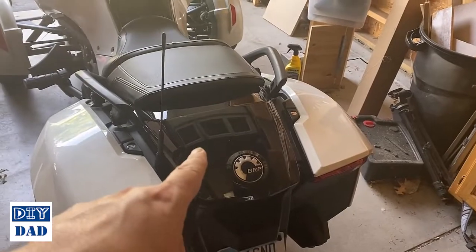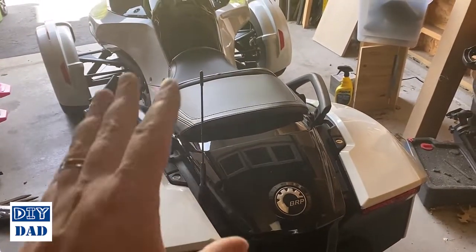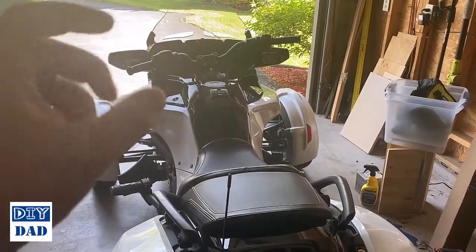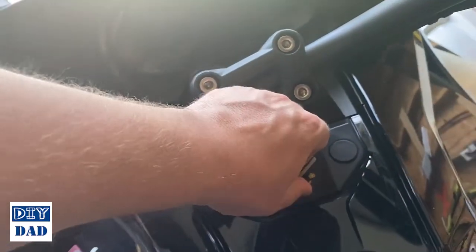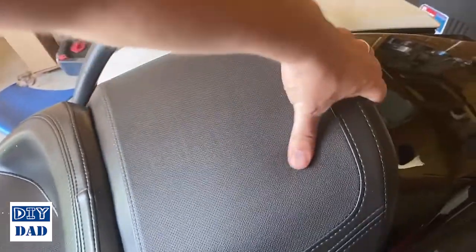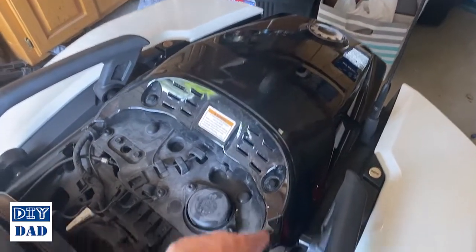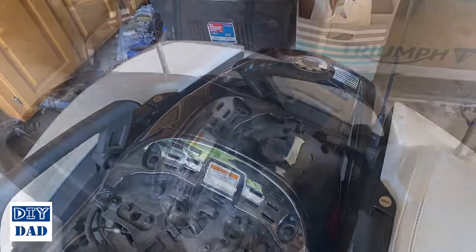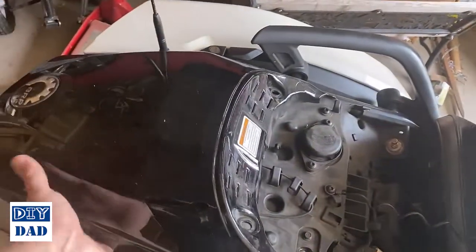To start, I'm going to pull this top cover plate off because I want to look at where the antenna is — I'm going to have to move it — and I'll take the rear seat off as well. To get the rear seat off, take your key and turn it to the wrench position. Push the key down and turn it that way — that releases the seat, then pull up and off. That gives us access to the pressure clips that hold this plate in place: one here and one here, and then the plate will click up and off. With the pressure clips removed, there are just three little body clips back here, so you grab this and lift it up and it pops loose.